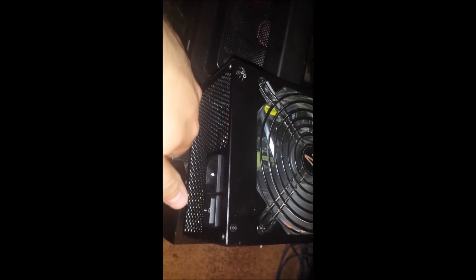Here's the finished product. I've got Molex into the adapter with the resistor, into the fan cable, and popped out the power supply. Make sure to avoid any points of pressure when putting this through — I pulled it through to where you'd have extra insulation to cushion it just in case. You can see it's fairly silent. This fan has a little bearing noise but it's nothing like it was, and there's definitely a good amount of airflow coming out of there.